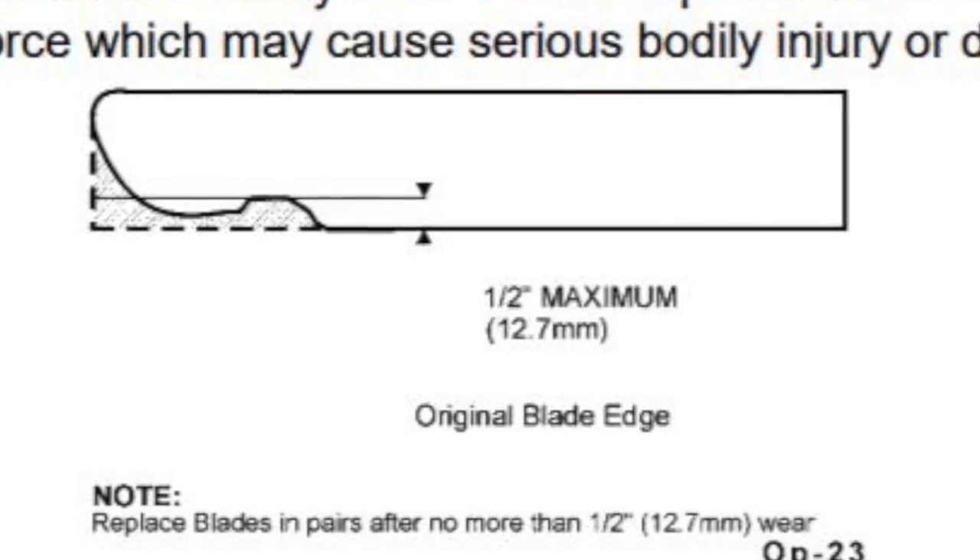The second time you're going to have to replace a blade — and I get lots of questions and emails about this — is when someone starts up their cutter and it's vibrating badly. A lot of times that's one of two problems. One of the more common problems is you've hit something and this blade is bent. This blade is probably about 10 pounds — it's heavy.